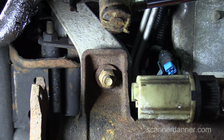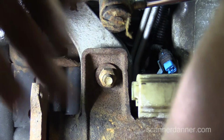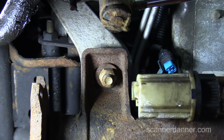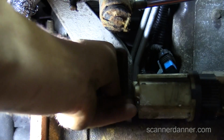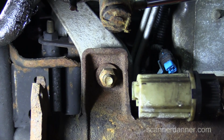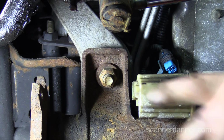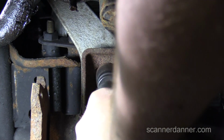All right, so a little bit of a concern here before we take this off is these are slotted. I wasn't that concerned. I'm just looking at where it lines up, and it's pretty much flush with the top part. We're putting a lowering block. I think once you bolt this in, those would be the last ones. Think about it, if you change a bushing and you got it pressed in a little bit deeper, there would have to be some allowance there to save those bushings. So I'm assuming you bolt these two up, get them snug, and that's where it lines up, and you're going to keep your bushings unloaded that way. Yeah. That would be my guess.